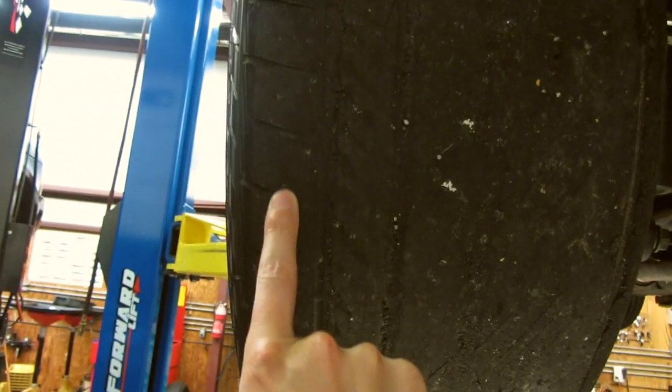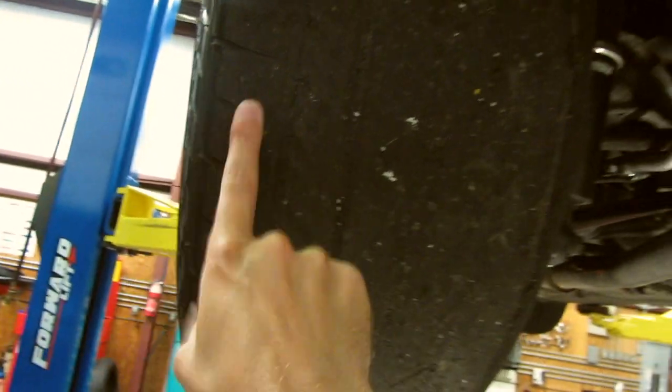We had a little bit of negative camber, but we have this car set up to, when it's sitting still, we are running a little bit of positive camber. And the reason why we do this is when we put it under a load, it squats, which gives it negative camber. And if you have the car at negative already and it gives it more negative, then you're even more negative. So we could have a flat surface after they get worn down. We put 1 positive degree in the camber. So both rears are at 1 degree of positive camber.